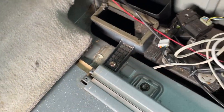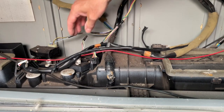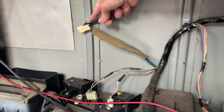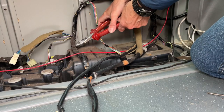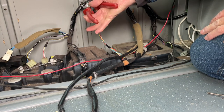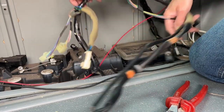There are three bolts in the top which I'll remove in a little bit, but first I've got to unplug all the wires. Most of them have just got little clips which hold them in - some are easily accessible, some not so much. There's one at the end which is really quite difficult to get out; it might be easier to get it out when the unit is half removed. I'm repositioning all the wires and taking all the little clips out that are securing them to the wall. There's also a wire that goes over the top on cable ties that needs unclipping. One thing to note: be really careful cutting the cable clips off so you don't accidentally cut a wire.